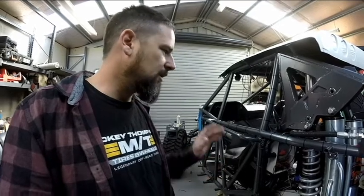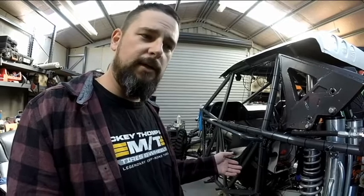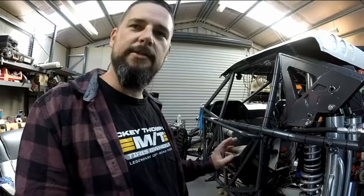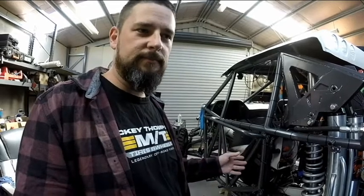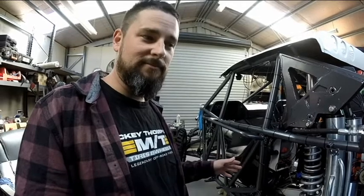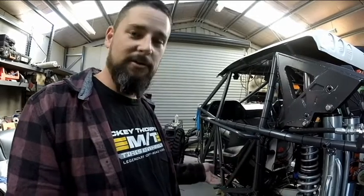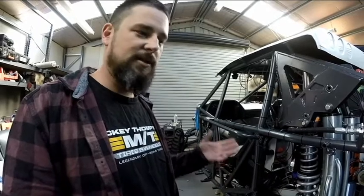And that's because the smart wire is going to come in whatever state it's in. And if you go and wire your car and then put power onto it, you don't know what's going to happen. It might start trying to turn the car over, it might start trying to run a pump, it might start trying to do something that you don't want it to do.